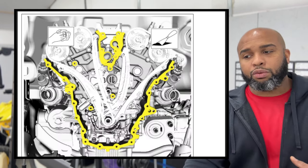And then the high pressure fuel rail, these two bolts. Now this is the one I said is hidden on the back that you won't be able to see. These get tightened down to 89 inch pounds and then 45 degrees. These are the two that I stated earlier. You will not be able to see that one in the back. It's kind of hidden, so you got to reach your hand back there. After you do that, just make sure you plug your electronics up and you should be good to go. I did not disconnect the flex fuel rail, so it was already still installed, so I didn't have an issue with that. Electronic plug, now we're good to go to the other side.